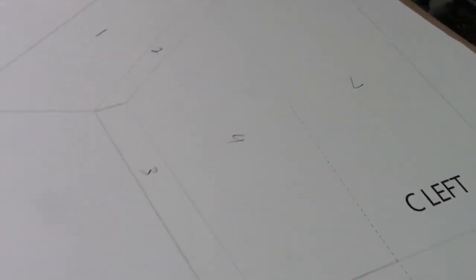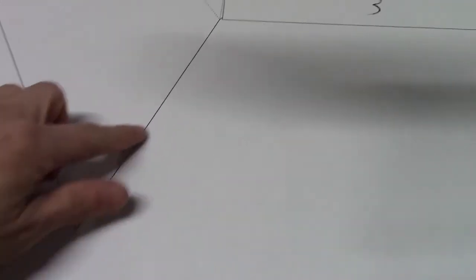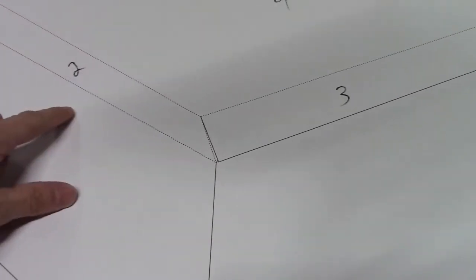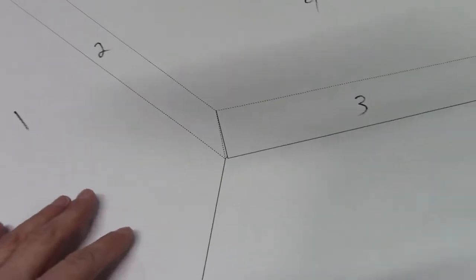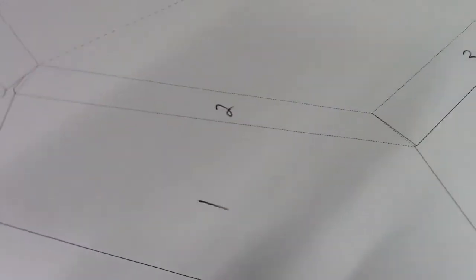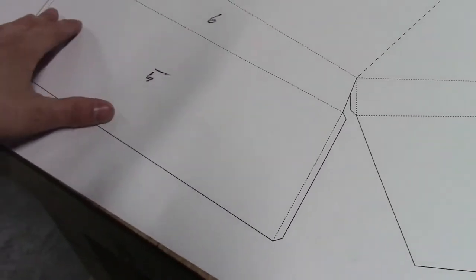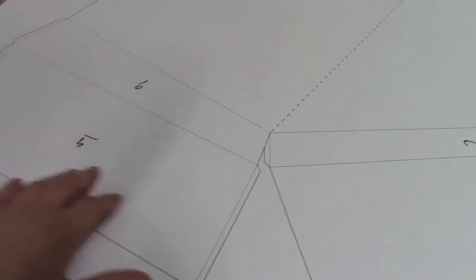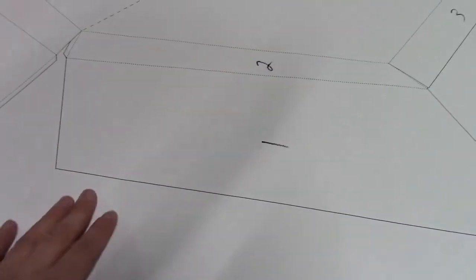Alright, so before we start cutting out these patterns, the way Pepakura works is that the different lines mean different things. So solid lines are cuts, dotted lines are bends. So you've got these different kind of peaks and valleys that you're doing here. Before I start cutting these out and laying them over top of the plastic to cut the plastic, I'm going to create just numbers on each of these different things, take a photo of it so I know how everything comes all back together again.